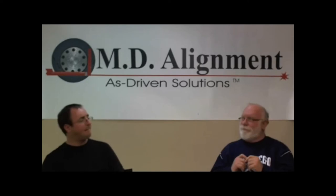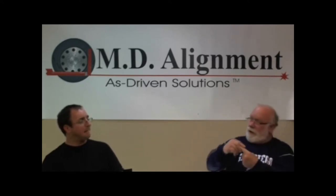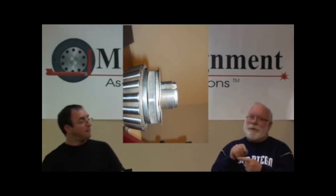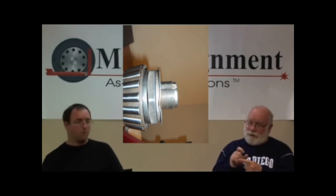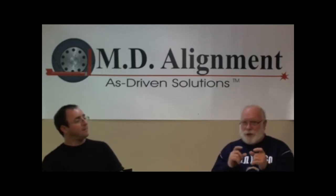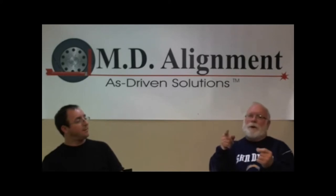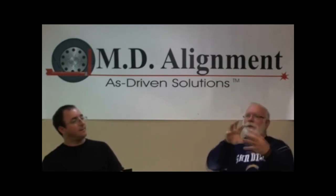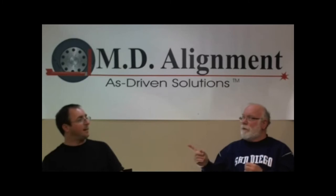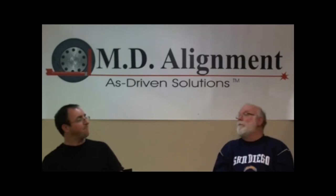Thread pitch. Now, on the end of that spindle where the nut screws on, there are threads, and there's two styles. There's a fine thread, which is 18 threads per inch, or a coarse thread, which is 12 threads per inch. What a 12-thread pitch means is that if you turned the nut 12 times, it would move 1 inch. So if you turn the nut one time, you'd move it 83 thousandths. The point is, it's a lot more than 5 thousandths. So one turn would be bad.